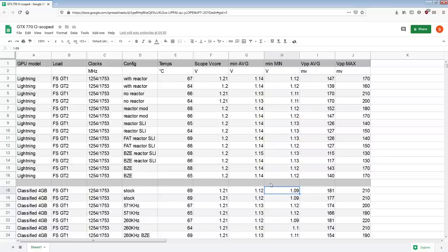The chips on both cards are not the same — the silicon quality of the cores on each of these 770s is not the same. They actually top out at roughly the same clocks on air cooling, but the Classified seems to be pulling way more power, so that chip seems to be significantly leakier. At stock voltage of 1.2 volts, the difference in power draw is much smaller than at 1.38 volts. The Classified on stock settings is about 30 millivolts worse in worst case scenario and 20 millivolts worse on average, which could translate to the Classified clocking maybe an entire 13 MHz worse if silicon quality were equal.